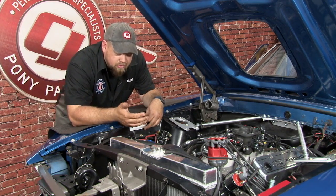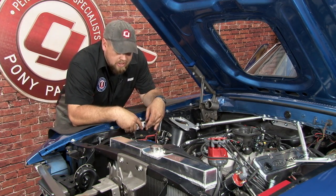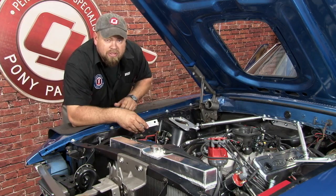Now, if you have an aftermarket apron or a damaged apron, this might move back and forth. You don't want to have too much play. A little bit of play is okay because when you tighten it down, it's going to straighten itself. But if you have too much, you'll actually hammer this slightly smooth to make sure you have proper clearance.